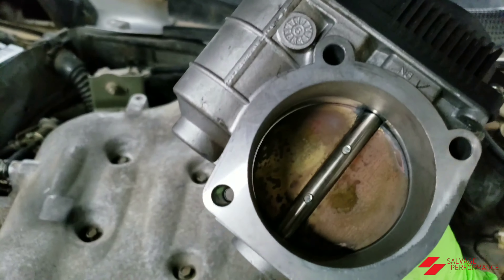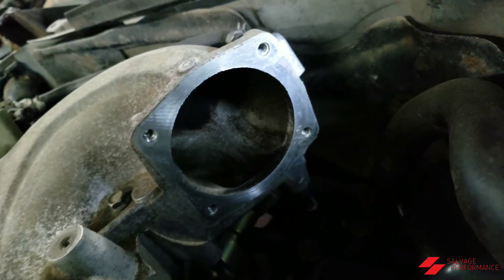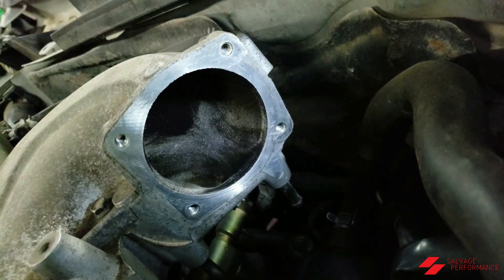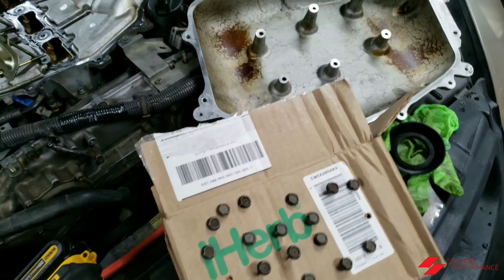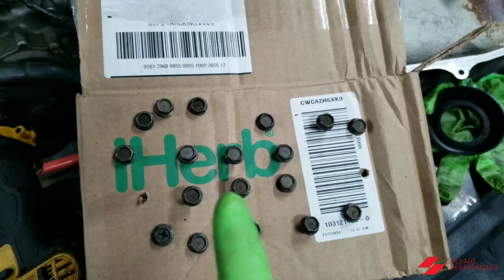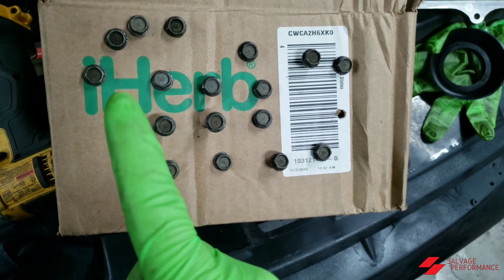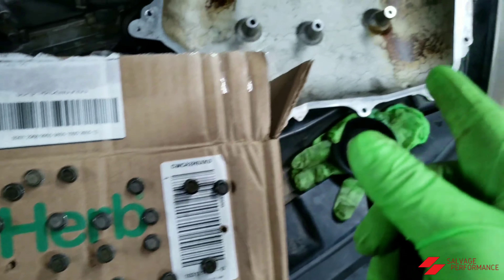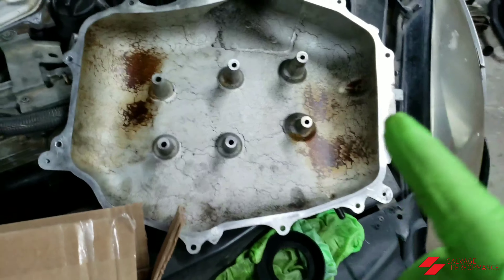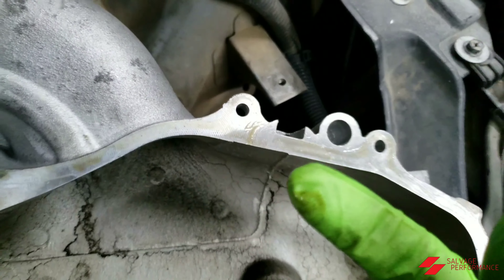I cleaned it out already — it's not the best job but it's definitely a lot better than what it was. I think on this car I am going to have to pull the intake plenum off because, as you can see, there is a lot of oil inside of this intake plenum. I took off the bolts — an easy way to remember where all the bolts go, because they are different sizes as you can see, is to just draw a diagram. I took a drill and drilled some holes in a piece of cardboard and slid them in one by one as I removed them from the intake plenum. Look at this — there is a lot of oil on here, some of it is even fresh.